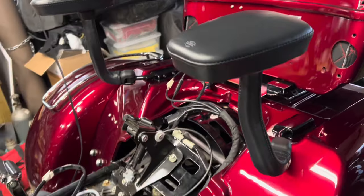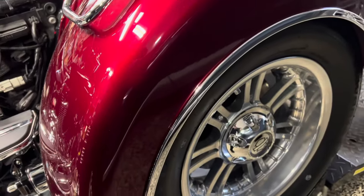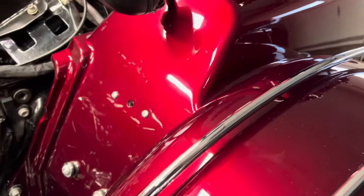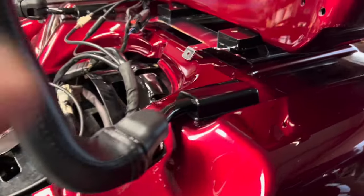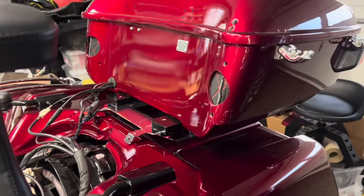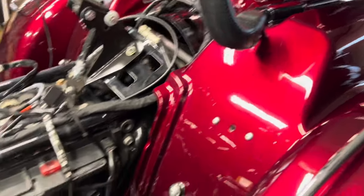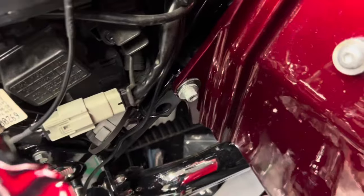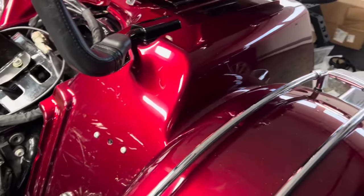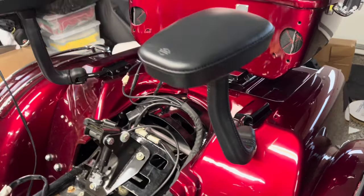In my case this worked out really well with the tub off. The instructions tell you to take your wheels off, and it's still a pain because not only do you have your fender but you also have the tub that comes down underneath — you've got to reach your hand up underneath to get to the plate that goes under there. If you want to take the tub off, you have to take the tour pack off anyway. There are only a total of eight bolts — six inside the trunk area and two on the outside, one on each side — and you can take this tub off pretty easily, get to your shocks, do some maintaining and cleaning. Personally I would recommend that, but that's up to you.